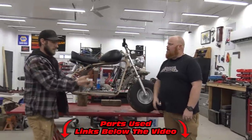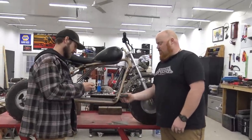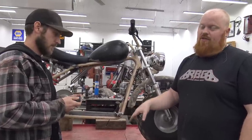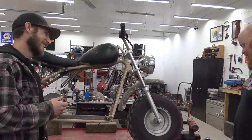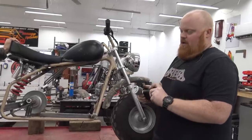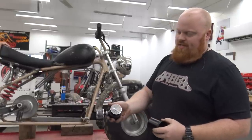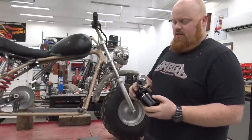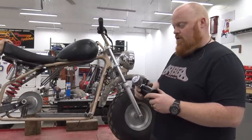They're super well made, that's a good ounce at least. We're going to show you for the 15th time how to mount these — they will snap on you eventually, every set we ever had. They're not good, they're cast aluminum. We're also going to mount our oil catch can. This is a baffled oil catch can from Amazon. It's double baffled with some windage trays in it, so it keeps oil from coming out your air filter on these mini bikes.